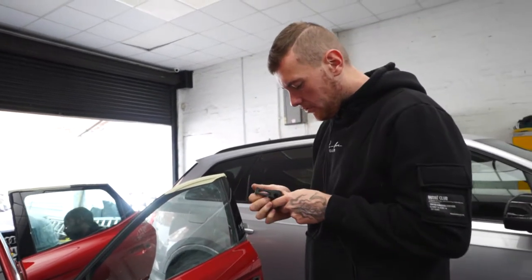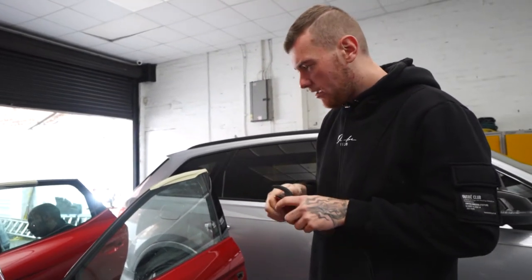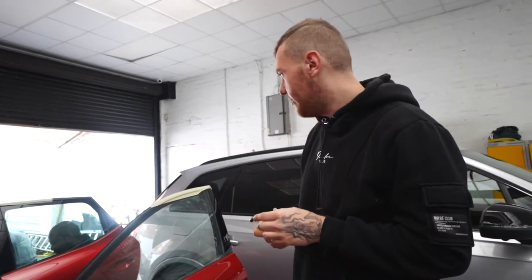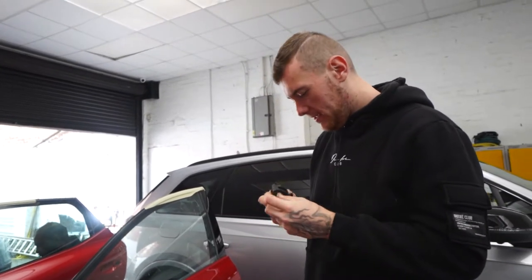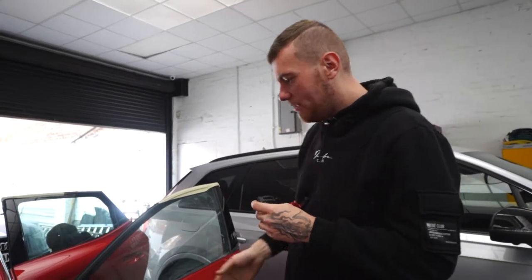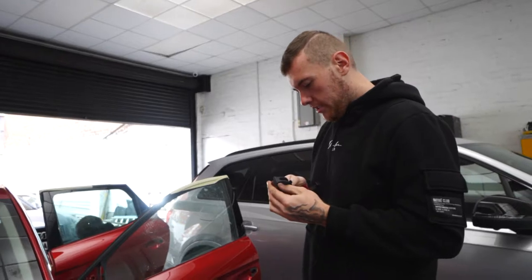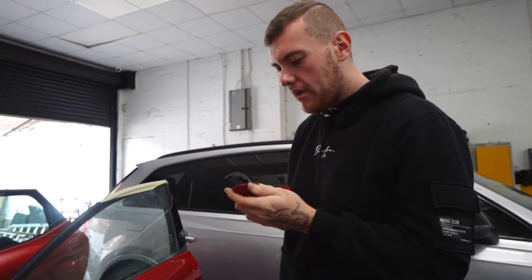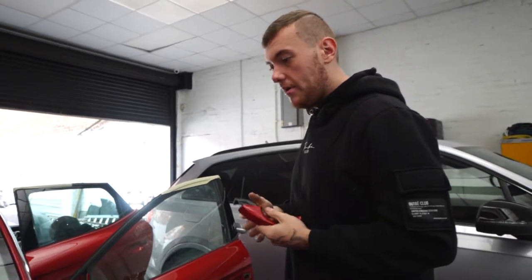What I'm doing today is I'm just building up this Seat Ibiza. We had both the doors stripped down to fully repaint them, and the quarter's been painted which has been mopping up now, which you've just seen. I'm just going to put the handles back in, the mirror and the weather strips - the stuff that we've taken out - just to make sure that we get a perfect clean job. You don't have to mask anything up. I'm just putting the rubbers back on the handle, and I'm going to build it up now.